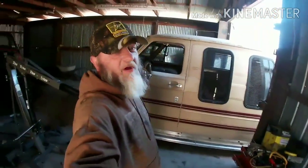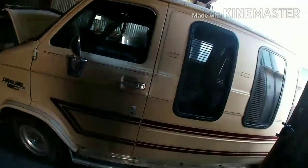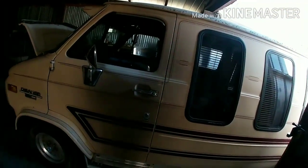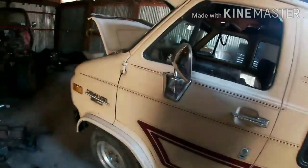Hey guys, y'all missed yesterday's video. She's running and driving. Gotta do a few things to it. Brakes don't want to hold her. Then I figured out, well, wait a minute, we got the vacuum line plugged off. So we're gonna hook the vacuum line up today and do a few other things.